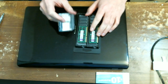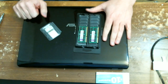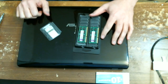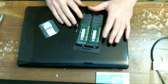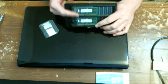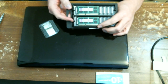So we're going to go ahead and open it up and take a look. This came with four gigs of memory — two 2-gigabyte DIMMs. I was lucky I got 1333 MHz memory, but I think that's the most you can support. Some people got 1066; it can support either. So this is two 4-gigabyte 1333 MHz DDR3 DIMMs.